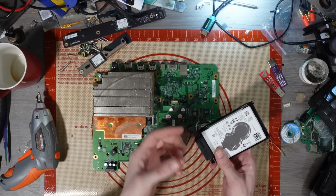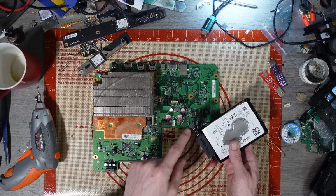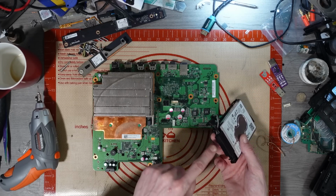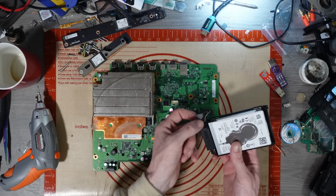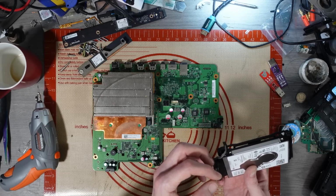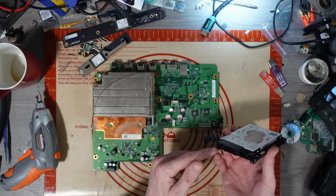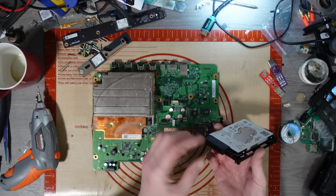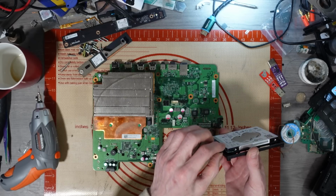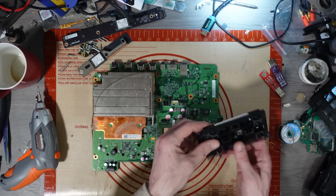So basically, with the Amphenol cables, Amphenol's the manufacturer, by the way, they broke somewhere, like the actual cable broke inside, because inside this is just wires, I think it is 7 wires, but the wires are really thin. I think they made them a little bit too thin, and they basically just snapped, probably because of the bend in the SATA cable. So they switched to Foxconn and they stopped having those issues.